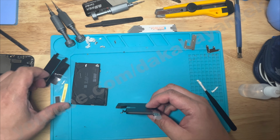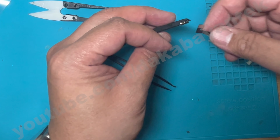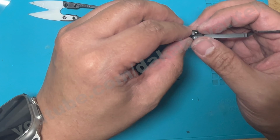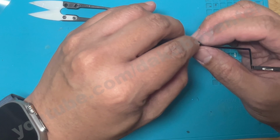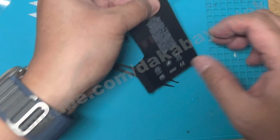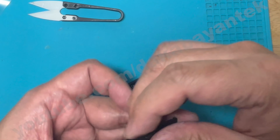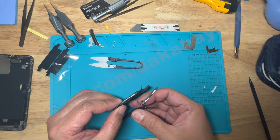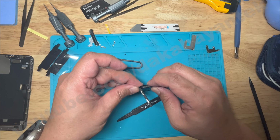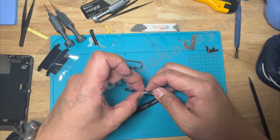Grab the new battery. Install the double-sided tape on the top of the new battery. Follow the supplier's instructions for the iPhone 12 Pro Max, folding the BMS board flex. Connect the original BMS board connector to the built-in tag of the battery, then fold the first corner on the old BMS board flex. Grab the provided mylar tape to secure the 2 connectors. To avoid micro-tearing of the BMS board, I strongly suggest using a heat blower to soften the flex while wrapping it around the battery. For the last corner, make sure the old BMS board is adhered to the top of the battery where the double-sided tape is located. And take note of the folded side of the original BMS board, that it sits aligned at the corner of the new battery.